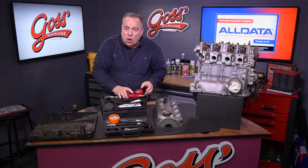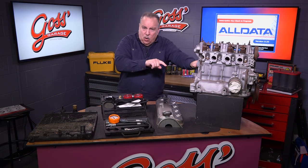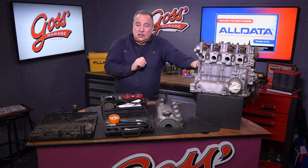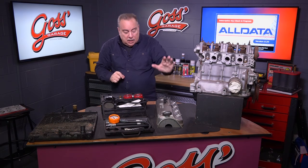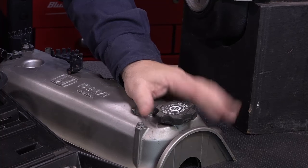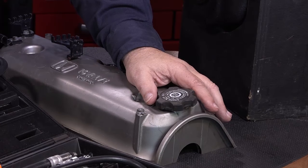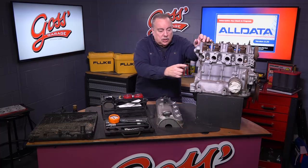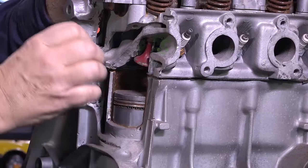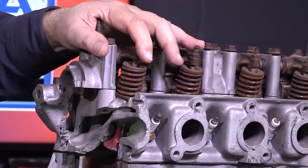You can go a lot farther with this than you ever could with a compression tester. If we're putting air in there and that air is leaking out, we simply have to find out where it's leaking to know what's wrong. One of the first things we do is take the oil filler cap off of the valve cover and listen to see if air is coming out through the valve cover. If it is, that means the piston rings or the piston — something in the bottom part of the engine — is worn, and the air is going past that piston into the crankcase and back up through the breather system and out through the oil filler cap.